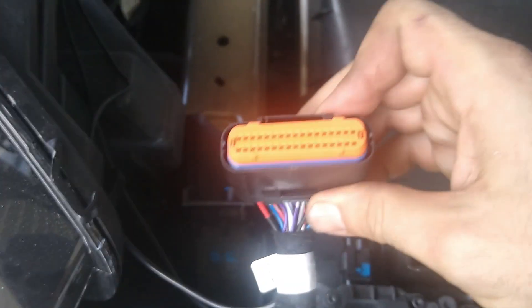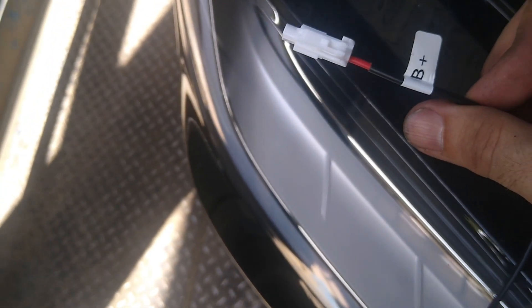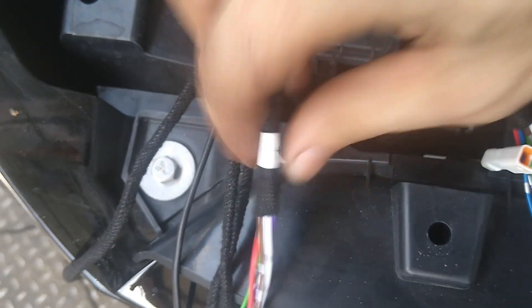So let me break it down for you. Some of it's obvious, some of it's not. The big plug goes into the central control unit — the head unit. The next big obvious one is the purple one that goes into the actuator motor — that's D5. Then B-plus for battery positive and ground is ground — those are obvious. And D3 and D4 go to the struts — also obvious.